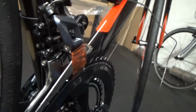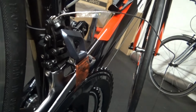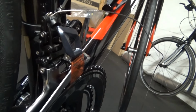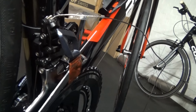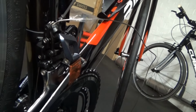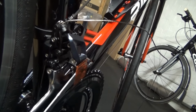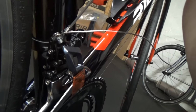Once you've done that, by adjusting, like I said, get your 2mm Allen key and adjust them, by just putting some tension. It's just tensioning the cable. So once you've adjusted them, you may need to go in, you may need to go out to adjust them. Once you've done that, and those two lines are lined up, then you're ready for the next stage.